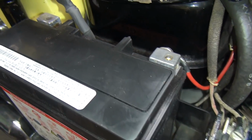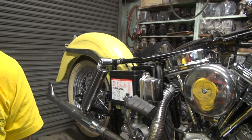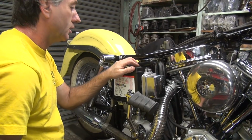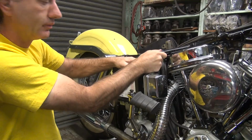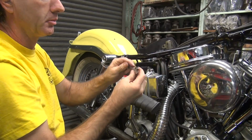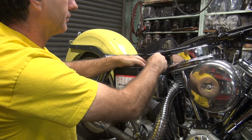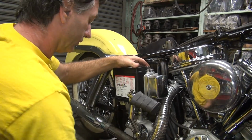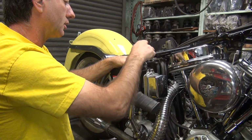I want to short. So I'll pull this one off and move it to the other, clean up. It has to go all the way down to the solenoid on the other side. So as long as this cable's not connected, you don't short when you're working on this side. Kind of important thing. Just want to get a bunch of arc marks on your wrenches. I'm sure there's none on this. We would never do that, right? Just enough drag you can't unscrew it.